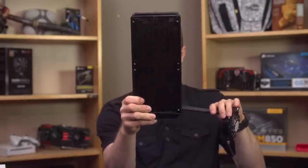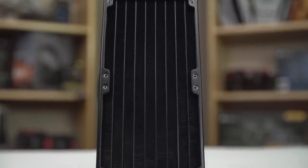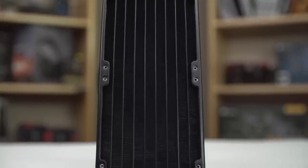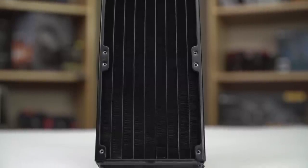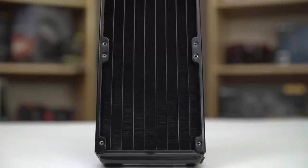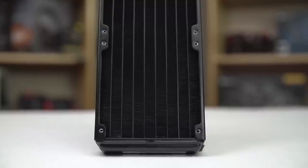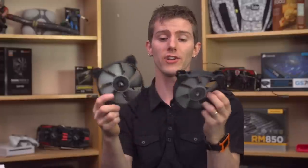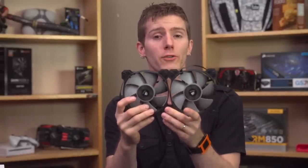This is because of the design of the radiator with a little bit lower fin density than I'm used to seeing with these all-in-one units, which I think is actually probably a good thing. Because as soon as you throw dual 120mm fans at cooling a single CPU — even if it's quite a powerful one, unless you're talking about extreme overclocking — it's pretty much enough, so you might as well go after silence. And speaking of silence, the two included fans are PWM, which is a nice touch, and they can operate from anywhere from 800 RPM to 2700 RPM.